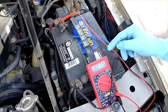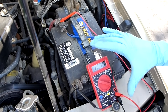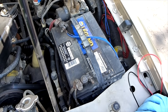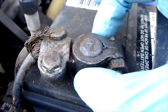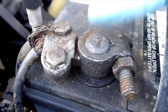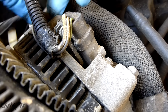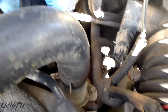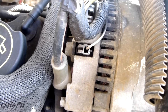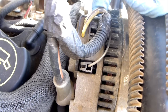If while doing these tests something doesn't check out — your voltage doesn't go up when the car is running, or when you turn all the accessories on the voltage drops below 13 volts — then check a couple of things. First, check the connections at the terminals: take the leads off and sand them to get a really good connection, because a poor connection will cause the alternator to have a hard time charging the battery. Also check the back of the alternator — make sure all the wires are plugged in and secured. Follow the wiring to the battery and check for any corrosion, damage, frayed wires, or kinked wires, as all that could cause a problem.